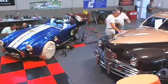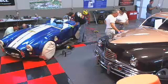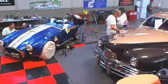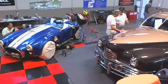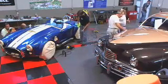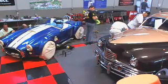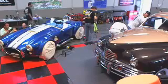I've done everything but this top portion. I went right to this. How much pressure are you applying? That's about, if that's zero, just fluttering there, for the polishing step, that's probably at least 10 pounds. For the correction step, up to 15 to 20.